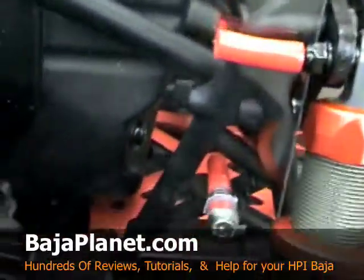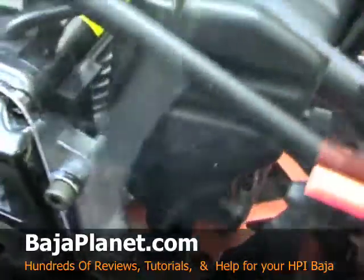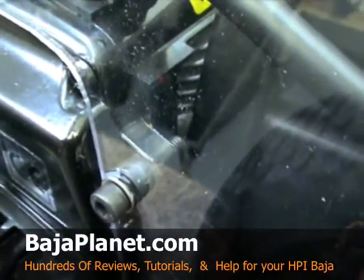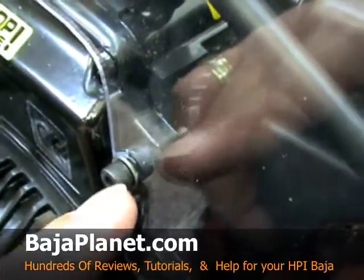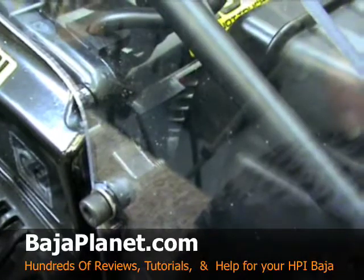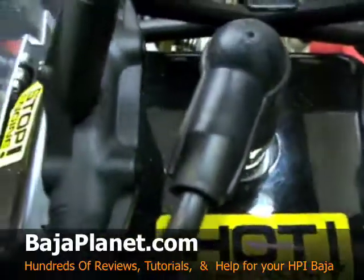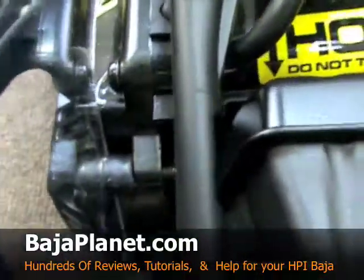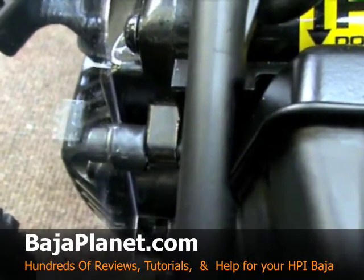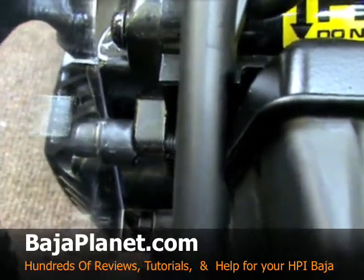We do have the center bolt on this unit. What it does is it goes through and utilizes the spare empty hole that's on your fan case. You're going to want to go ahead and use your allen wrench and screw that in just until the spacer touches, maybe a little bit tighter. You don't want to over tighten it — just screw it in until you get just a little bit of pressure on that standoff piece of rubber.